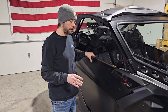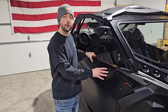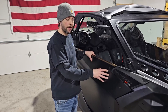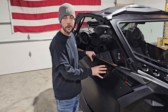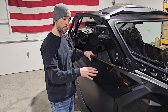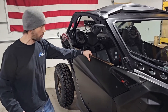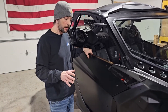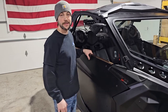So one last little thing about our doors that sets us apart from others: our door skins are made from 80-thou thick 5052 aluminum — pretty much aircraft grade that you can still bend. It is stronger than your typical 3003 aluminum that a lot of the other door companies use, and it's thicker. Also when they're latched, there's no vibration — you can physically move the whole car with the frame and it's rock solid. We definitely strive for quality here and we want you guys to have the best out there.